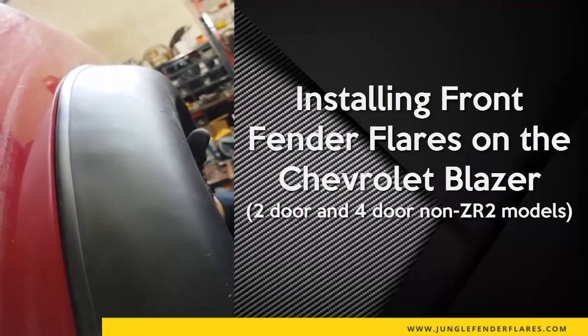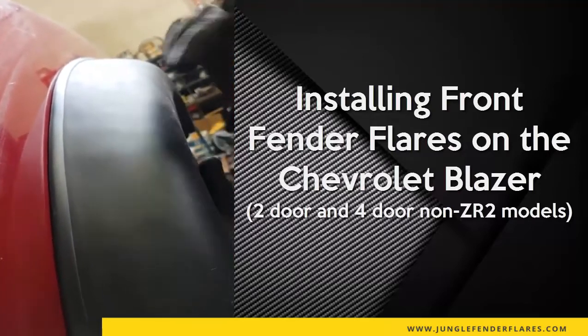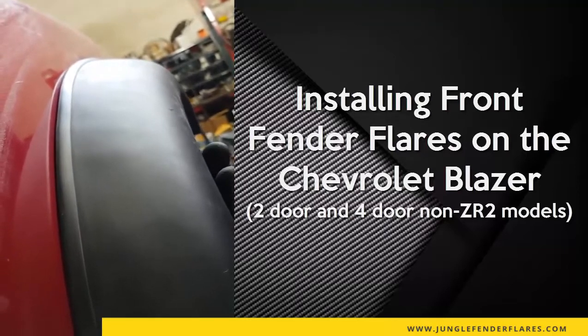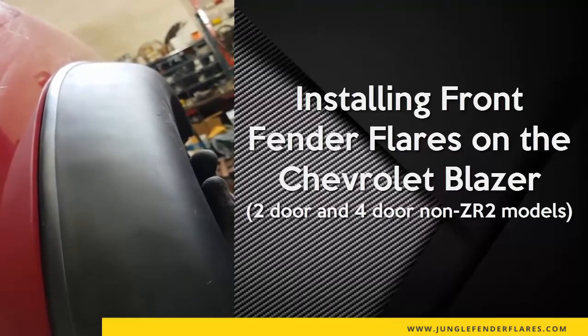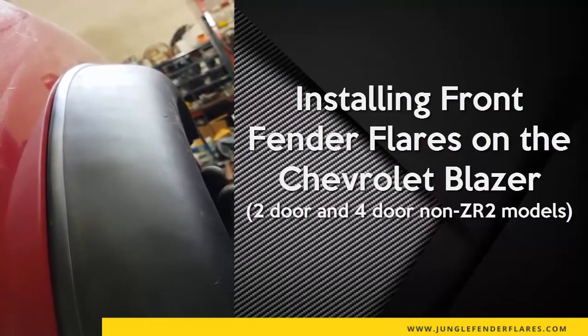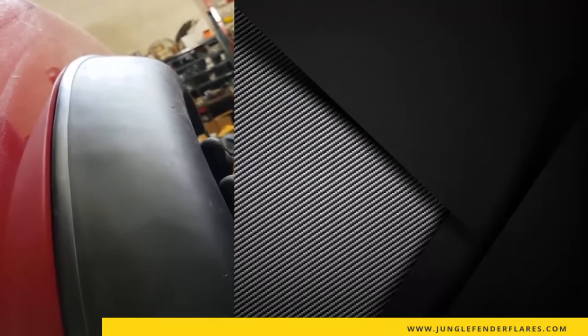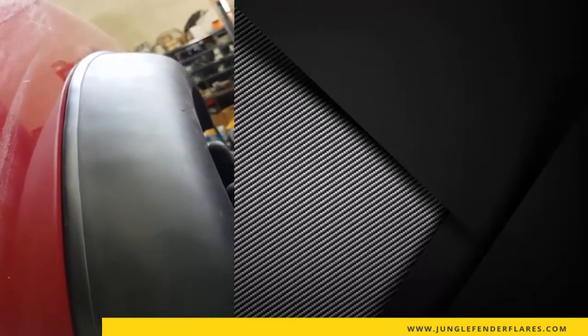you might run into a small issue with the fitment up near the top. You'll see there's a bit of a gap. So you don't want to drill your holes in your fender until you eliminate that gap. So as I push on a certain part of the flare, it sucks the gap into the fender.